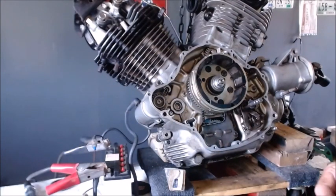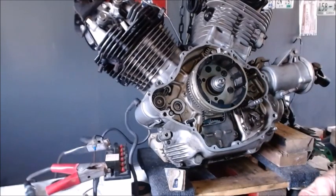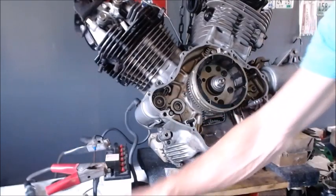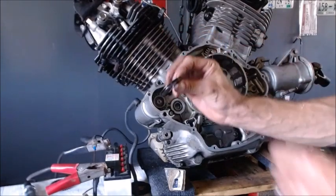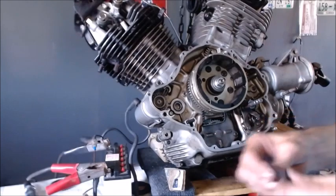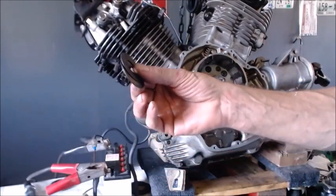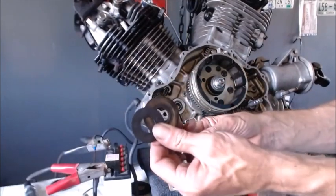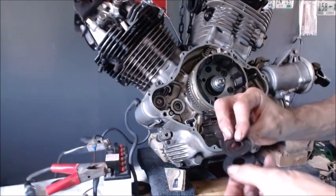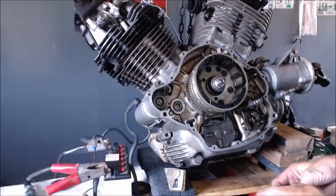All right, so we are set up to reassemble this with the shaved cover. I tried to do an assembly and discovered that the shim right there with the rubber damper in between is too thick for what we can get off of the cover. So I just took a torch and heated it up just a little bit, got that rubber soft and took it out of there. So now we got two little shims of nice hard steel that we can put what used to be the rubber side to what used to be the rubber side, and now we can do some reassembly.